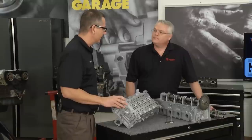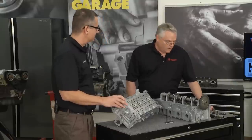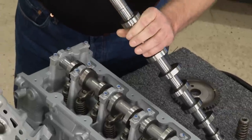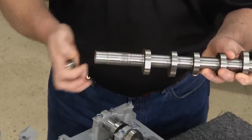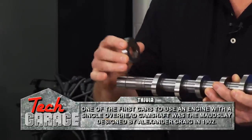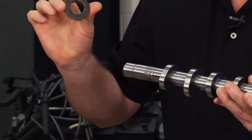You're not only just getting that — I see you have a camshaft there. You're also getting a camshaft with the complete cylinder head. This happens to be a single overhead cam Ford motor, 4.6 liter. These are the cam profiles — they form these out of powdered metal. The camshaft starts out as a high-quality steel tube that is rough machined with little grooves and ribs. Each one of these lobes is positioned and clocked correctly, and a ball is forced down through the center of the tube, expanding it into the serrations of each cam lobe to hold it in place. It's a pretty cool manufacturing process.